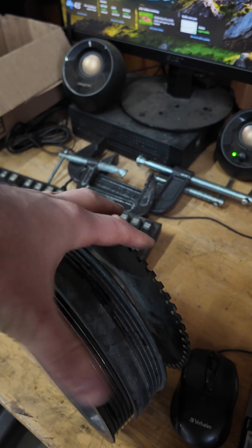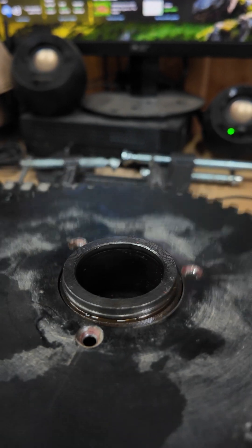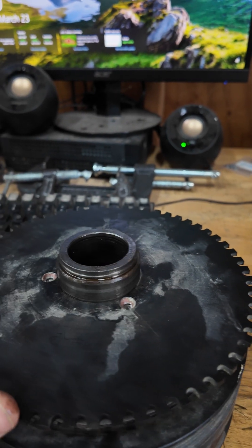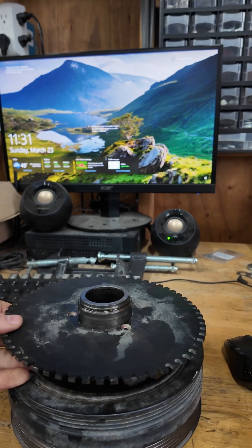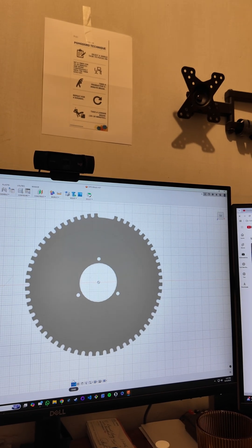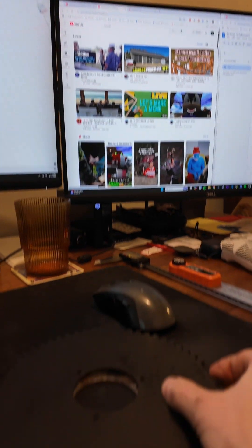In the meantime, I pulled out the harmonic balancer that came with the ACE kit to see how they handled the tone wheel. It's actually super simple — this disc just screws to the back of it with a snug fit around the collar and three countersunk M5 screws, which seems pretty simple. If we wanted to reproduce this, we'd just get this plate laser cut, drill and tap our own holes. When the pulley is pressed into the engine all the way, there's actually enough gap for this plate to fit fine with plenty of extra room. Back at the computer — there's the 3D shape, easy as that. I 3D printed a mock-up and it overlays perfectly.